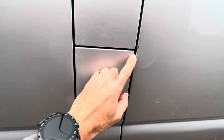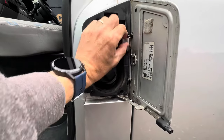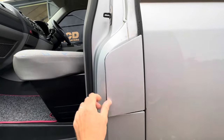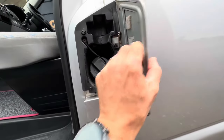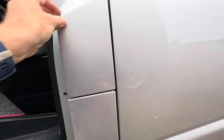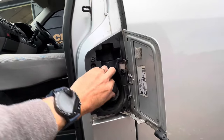This is quite common: where the fuel flap has moved back and hit the door, or vice versa - the door's been slammed with the flap open. These flaps can be a little bit problematic with age. This spring clip here is a bit loose - it needs to be nice and tight so when you pull the flap shut it springs it closed. You can easily adjust how these flaps sit using two little torx bolts; loosen them off and you can move the panel around to get a nice gap.